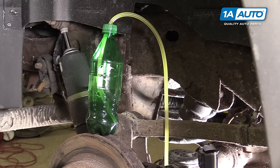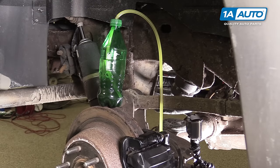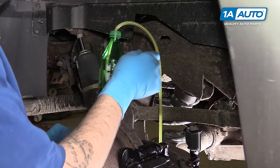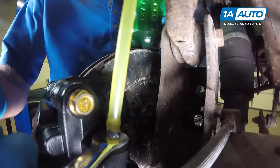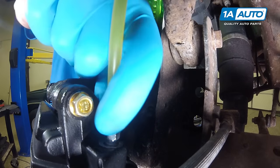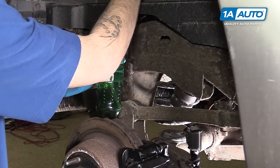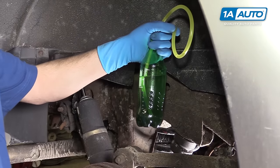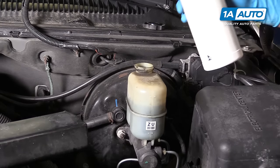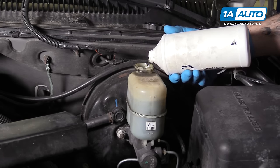After a little while, there will be no more air bubbles coming out. It is okay to get out of your vehicle and look at the hose — if there are no air bubbles in the hose, then there's nothing coming through and you've got it all out of that brake line. Now that our brake fluid is nice and clear and there are no bubbles left in our line, we'll close the bleeder screw with our 10mm wrench — make sure you get it nice and tight so it seals up. When removing the hose, pinch the bottom nice and tight; it is just rubber hose so you should be able to pinch it off, lift it up, and let go to drain all that fluid back into the bottle instead of onto the ground, then move on to the next cylinder. Check the master cylinder after bleeding each corner, because if the fluid runs too low and air gets into the master cylinder, you'll need to bleed the cylinder and start the entire process over.